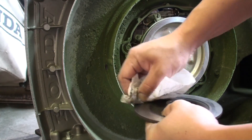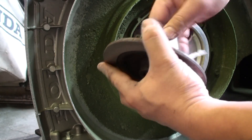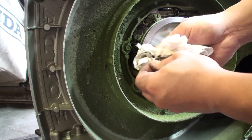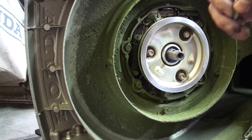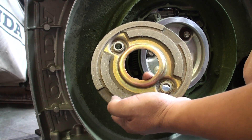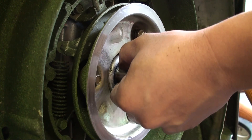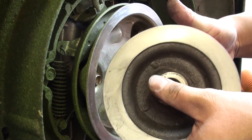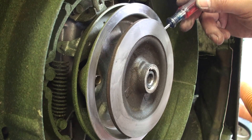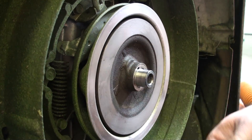Give the drive disc a good wiping with brake cleaner to take off any grease from your fingers. Clean the inside and remove any corrosion to make assembling onto the shaft easier. Give the woodruff key a good wiping too. I personally wouldn't spray brake cleaner onto the actual driven disc itself because you don't know what it may do to the binding agents in the clutch material. To assemble, take the woodruff key and place it half-moon side down into the output shaft, then line up the notch on the drive disc. Use a flat-bladed screwdriver to help manipulate the woodruff key. You know it's seated right when it goes in smoothly and you can't turn the disc.